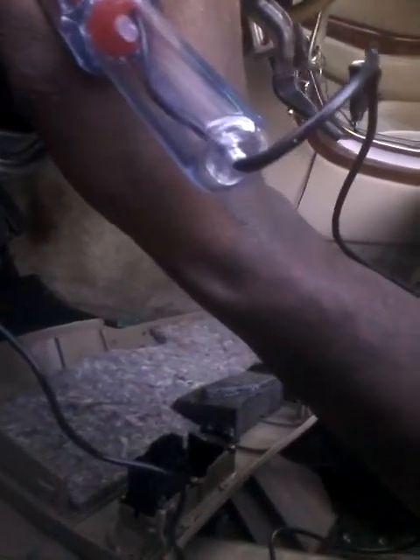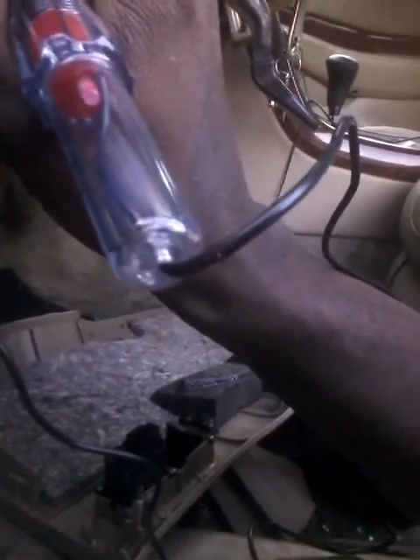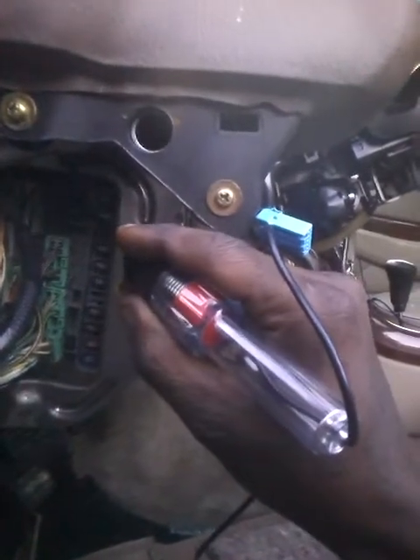This fuse right here is not lighting — and this is the starter signal fuse. I'm getting power on all the rest of these, they're all lighting up, but the starter signal fuse is not giving me any power or any light. So that's how you do that. I'm Dusty, DG Technician — y'all know my slogan: subscribe, keep me alive. Thanks for watching, hope you learned something.